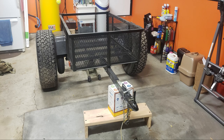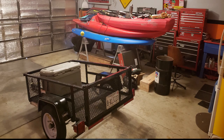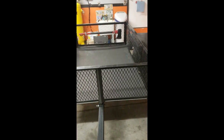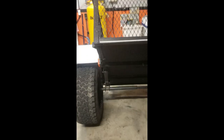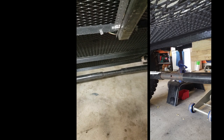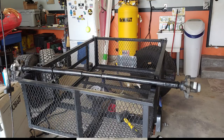The idea is, eventually when I go on trails, I want to be able to tow this behind the Jeep and not have any problems with it. I also want to load the kayaks and paddleboard on it whenever we want to go to the lake or ponds. Basically what I did was cut the axle in half, put a solid steel rod inside, drilled holes in the axle tube and plug welded everything together, then welded around the seam. That stretch gave me the actual width I needed for the wheelbase.